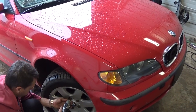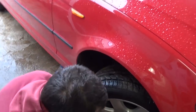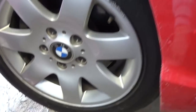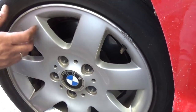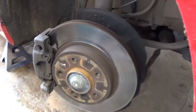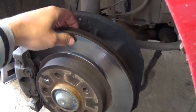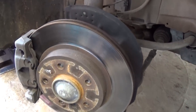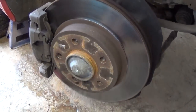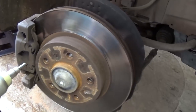If it's not a tire, then it's the brakes, which means the rotors are not good. They need to be either replaced or you need to cut them — turn them — and make them nice, smooth, and straight again. We're going to show you how to replace the brake rotors. In our case we'll be turning them, not installing new ones, because they still have good life left but they're too glossy and have a few high spots that cause vibration when you hit the brakes.